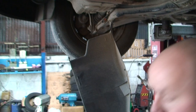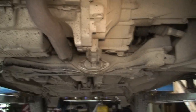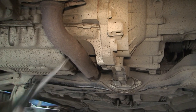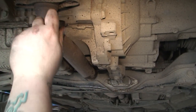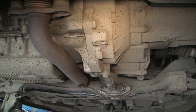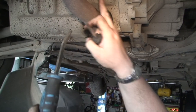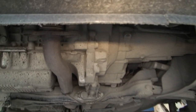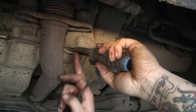Now we're ready to crack the sump. The next important thing is when you've taken off the sump - obviously there's sealer on it so the sump is still quite stuck to it. Do not use a screwdriver and hammer it in between there because you're going to damage either the sump or the engine - you'll leave a little nick in it which means it's going to leak. You can get a lever bar - there are special points on the sump the lever bar goes into. There's one around there and I believe there are some more around the back.